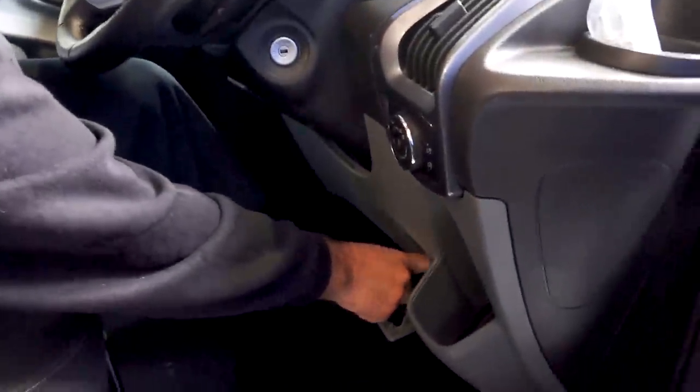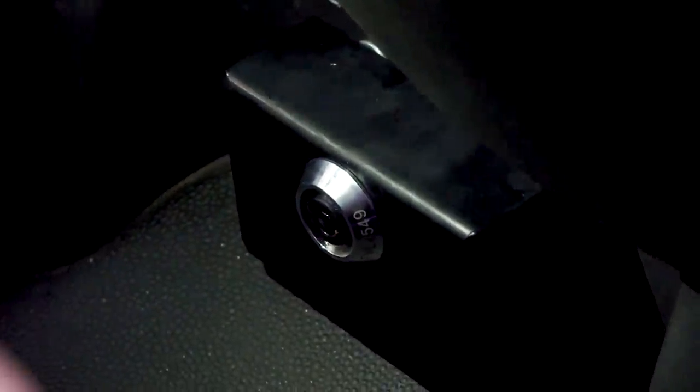We've also done something to help prevent the vehicle from being stolen: we've taken the OBD port, which would have been inside this cover here, and put it inside a locked box in the centre of the van. The OBD port is something mechanics use to reset your service light, but thieves can use it to code their own key into the van — and before you know it, they're driving off up the road. So by protecting that port and having the extra deadlocks on the cab, that's some protection against the vehicle actually being stolen. We also fit immobiliser systems — some which are very clever, where you have to tap a sequence of buttons on the steering wheel before you can drive the van away. Otherwise it won't drive, with no visible signs that it's on there. That's perhaps an alternative product to the OBD port protection.